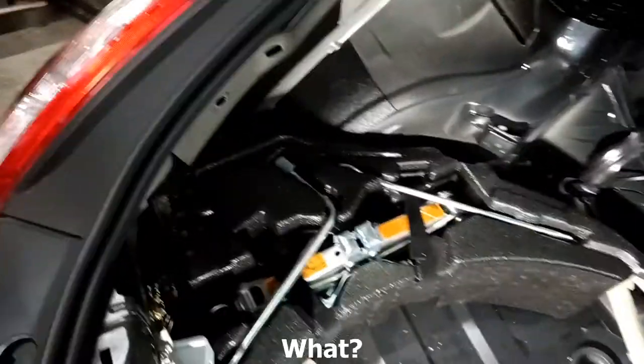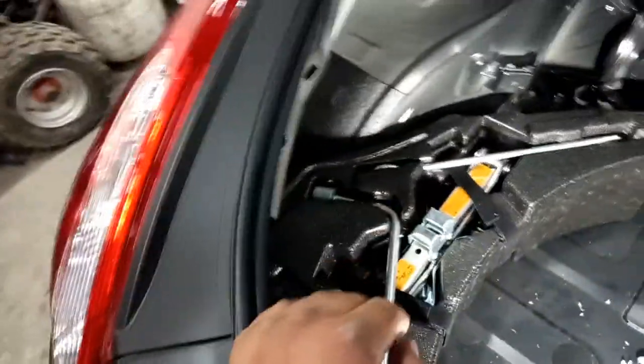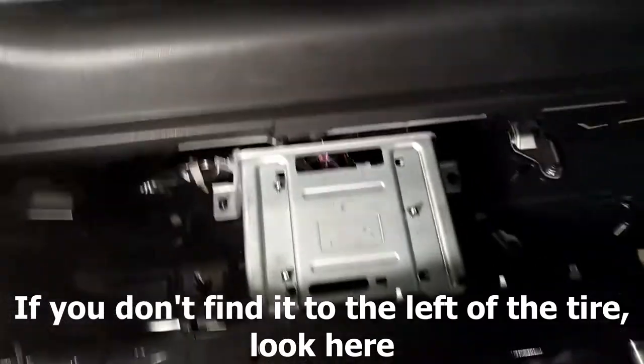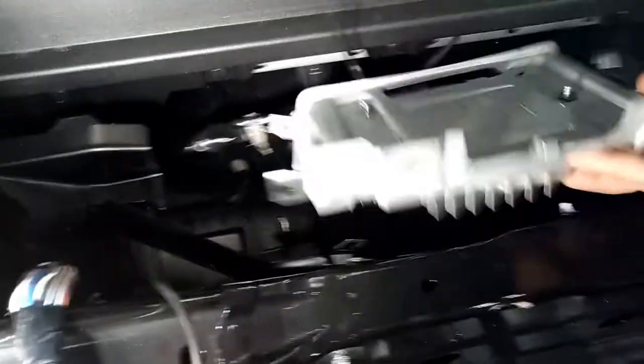This foam piece goes in here, and then the floorboard covers it, so this is the area where the amplifier is. I was online for a while and everything seemed to suggest the amplifier is under here — it wasn't. It's actually in front of the spare tire. Most forums on these 370Zs say it's under there — it is not. I already removed the bolts. You have to take off a body roll brace that goes across here, then remove four 10-millimeter nuts, and now you have access to the Bose amplifier.